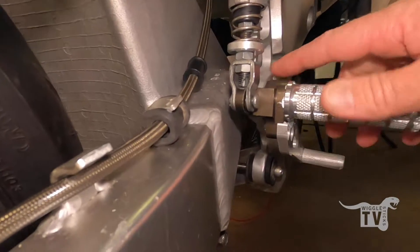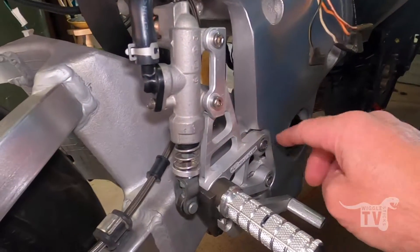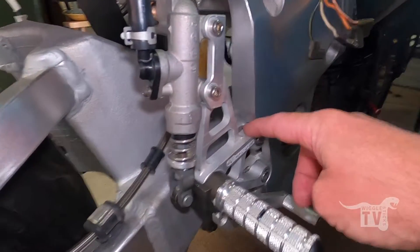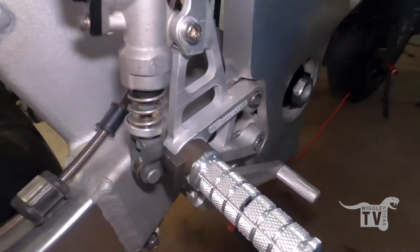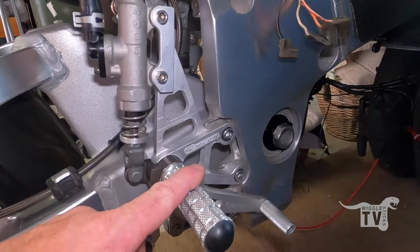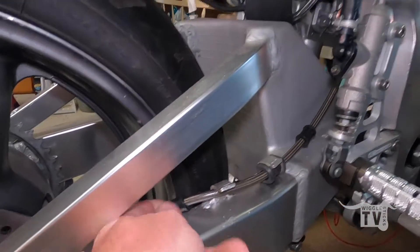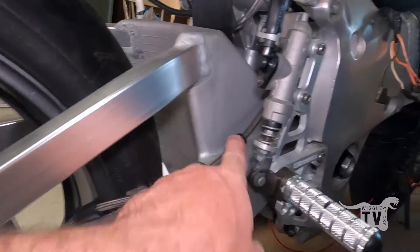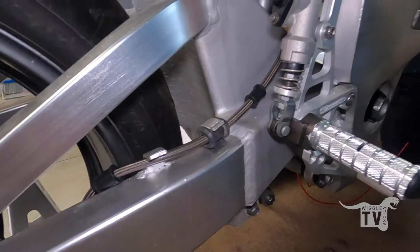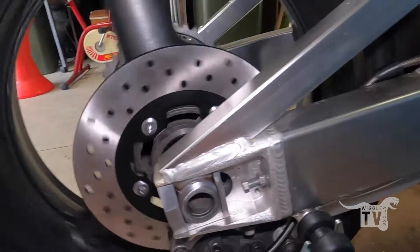I think this part of the rear set is either bent, or I need to check the other side to see what damage is on there, because I did restore this set. So I have to pull this off and just see what's happening. I also need to move these little rubber things up the line a little bit so they fit into the space better. I'm just going to go ahead and bleed the system and hopefully we'll have some brakes.